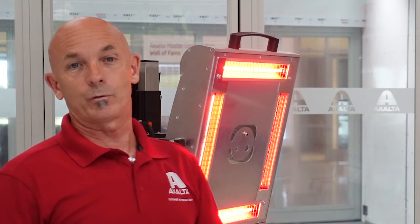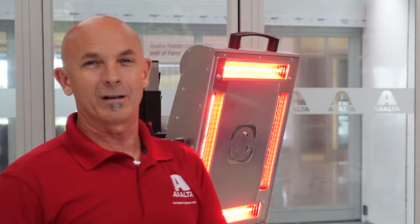Make sure to review each layer to find out the root cause. Just because it shows up in the clear coat doesn't mean the issue was caused by the clear coat. It could have been any layer in the paint film that released the solvent.